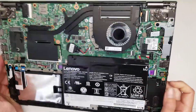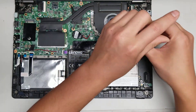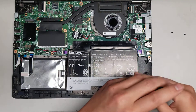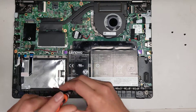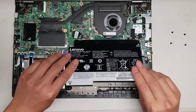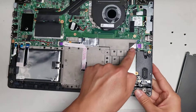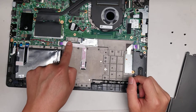I'm not sure if this cable is going all the way across because the connector is different. I can open it up and check. Usually I don't do this because I don't want to damage more things, but since this computer isn't going to be used I'll take it apart — there's no real risk here. There's some tape holding the battery connector; I'm just going to lift it so I can see what's underneath. There's one board here, a separate board for the SD card slot, and a connector for the trackpad. There's also a connector going underneath for the keyboard backlight.